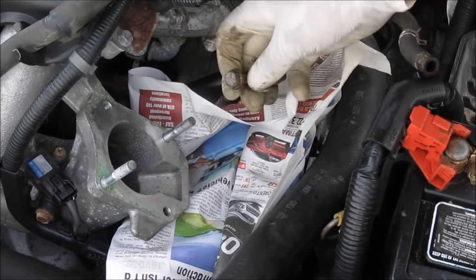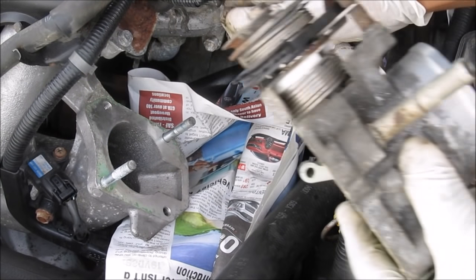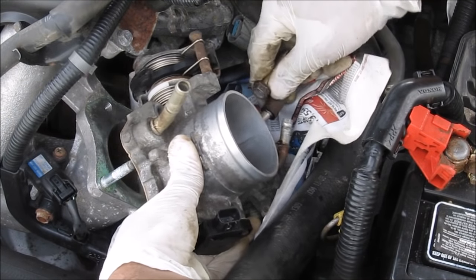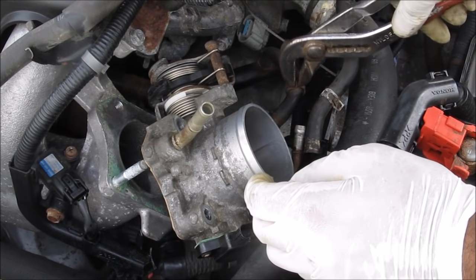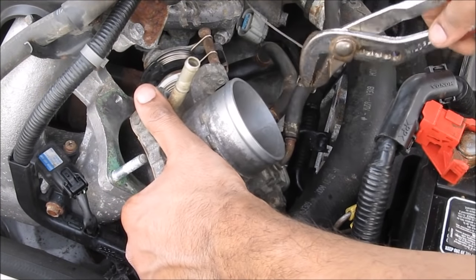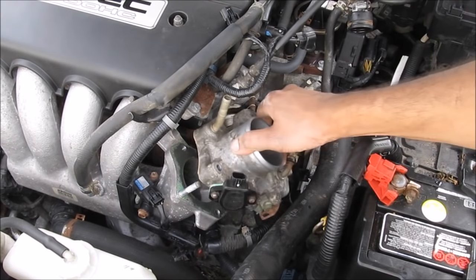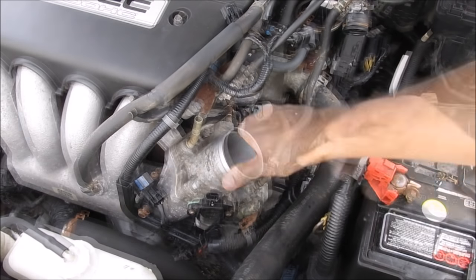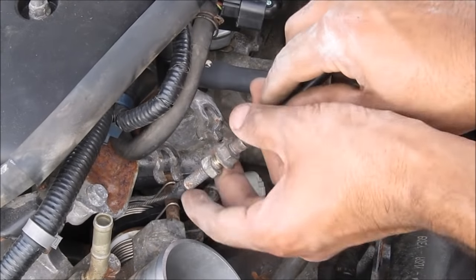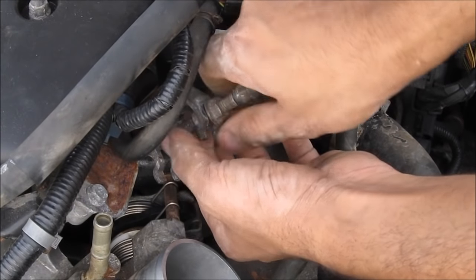I've got some newspaper down in here. I'm going to first remove the plug from the lower hose and then bring in the throttle body and connect it, trying to avoid any leaks. Then I'll use the pliers to bring in the pinch clamp and replace the other coolant hose into the throttle body and replace its pinch clamp. At the back I'm going to replace the throttle cable and then place the throttle body back onto the studs of the intake, catch the 12mm bolts, and snug them down. Next I'm going to replace the accelerator cable, making sure I don't change the adjustment, and then tighten it with a 12mm wrench. You want to make sure there's just a very slight play in the throttle when it's at idle.